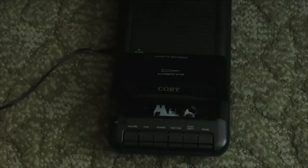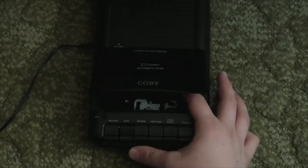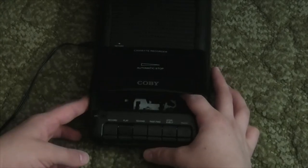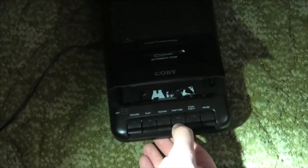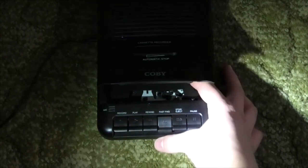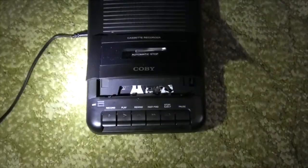I'm going to demonstrate the auto-stop. So if there's no tape in there and you push rewind, you can see how the button pops up. If you push play, there's no tape in there but it still spins the spindle — you can probably hear the motor running, it's really that loud. VWest Life did a video on how to lubricate cassette motors if they're loud like this. Once it gets to the end of the tape, if you put your finger on the spindle to stop it, watch the play button — it took a second but you saw the play button flip up. Same thing with fast forward — if I put my finger on the spindle and stop it from moving, you see the thing pop up. That's the full auto-stop in action.